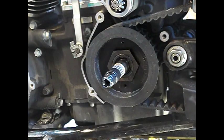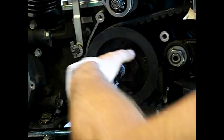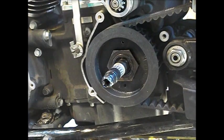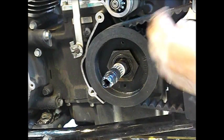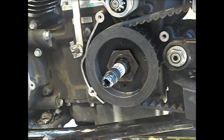I'm going to go with the notion that the chances are it's actually going to break away from this. I've read — and obviously if you're into this yourself, hopefully you've done some of your own homework — you've read that this can be quite a nut to get off a bike. What I have done is I've put the gear shift lever in third gear and I've also leveraged down the brake pedal, so it's really tight and it's being held. I've tensioned this back up a little bit more than the average bear, so it's on tight. The belt itself is in good shape, by the way — I'll be reusing that.